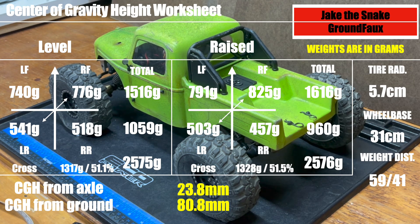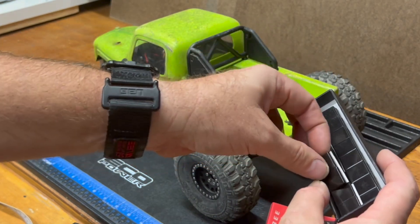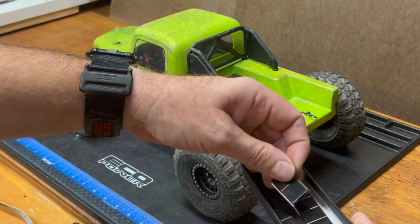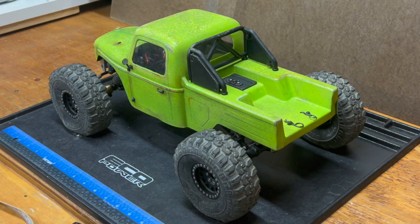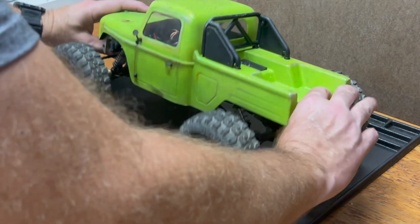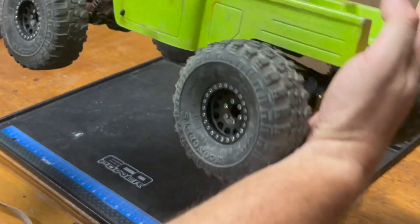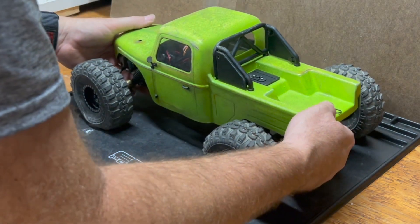There's the opportunity to add and remove weight. You can get boxes of automotive weights - they're steel now so slightly bigger than when they were lead, but nice and black and unobtrusive with self-adhesive, and each one is seven grams, so four of them adds an ounce. You can stick them on your servo or on the axle. The only problem on a CMS rig like this is there's not a ton of places to slap weight, because anywhere else you're adding sprung weight - and that's another topic for another time: unsprung versus sprung weight. That's how you get CGH.